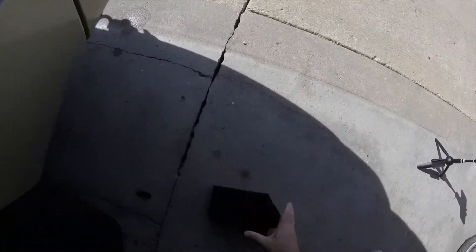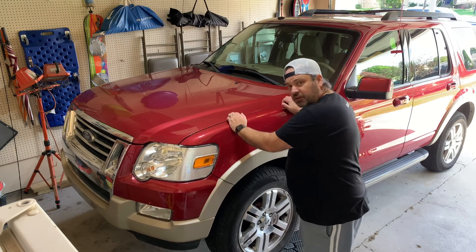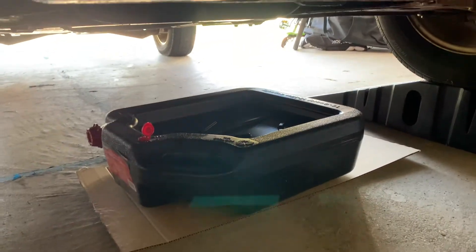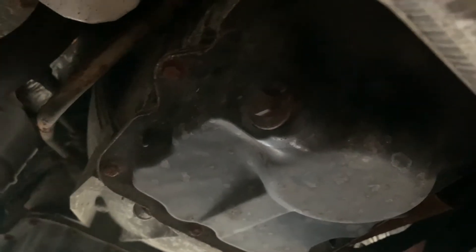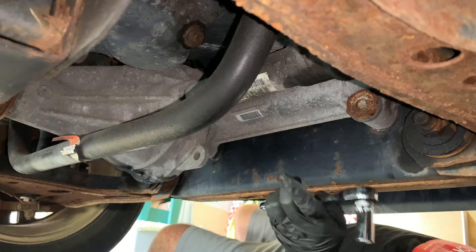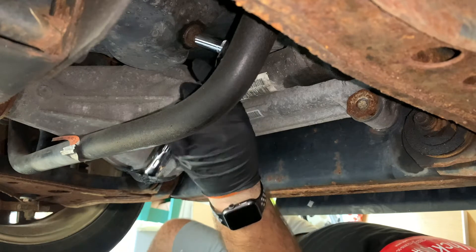All right, we got this side. Give a little push to make sure it's not going to fall off those stands. I've got a piece of cardboard here just in case there's any spillage. As you can see, there's our oil filter, and this black pan here is our oil reservoir, and you can see the drain plug right there. Under the truck now, we've got a five-eighths socket on our three-eighths wrench, and we want to make sure we're going lefty-loosey-righty-tighty.